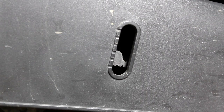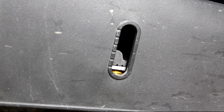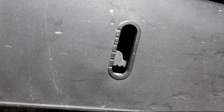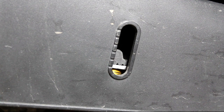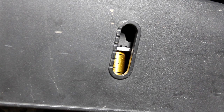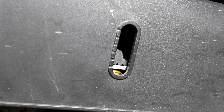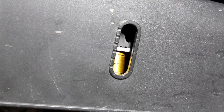Now that we've got the valve stem in the nine o'clock position, we're going to go ahead and test it again. We can see that we fall right about the same spot as the first one, right in between the first and the second line. So we'll go ahead and put that ten pounds of pressure on there. We can see that we're actually just a little bit higher than the first one — running a little bit closer to that fourth line, which is going to indicate that we've got probably closer to about thirteen millimeters of play.